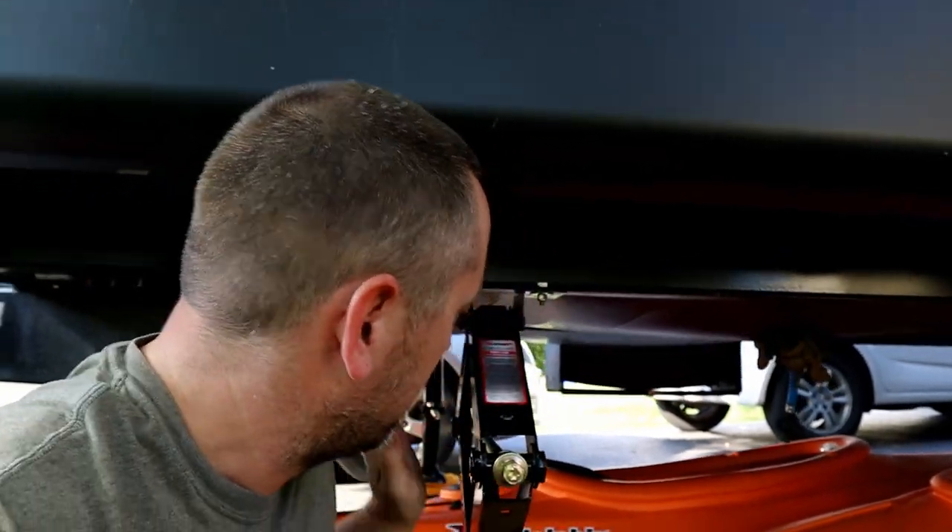Makes a big difference. I don't even think a scrap metal person would want these old ones — they are just that crappy compared to the new ones. Again, Libra 7,500-pound stabilizer jacks. So we replaced the jack stands and it is a lot better — probably at least 50% less wobble in the trailer, if not more. They make a huge difference. They're not cheap in quality — they're a thicker sheet metal, a lot higher quality. You can use a drill bit for them to take them up and down, unlike the ones that come with the trailer where you're not supposed to.